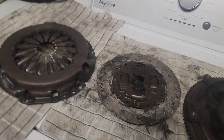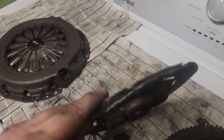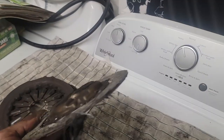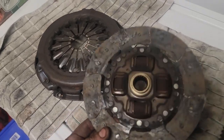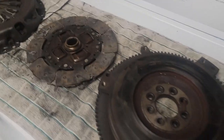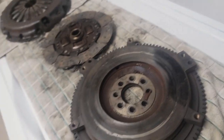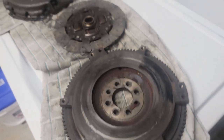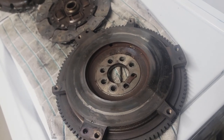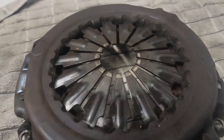For the flywheel, only eight bolts to take off — these are 12-point 14mm. Taking a look at the clutch, it is absolutely smoked — just shredded. There's nothing left; all the organic material fluffed out everywhere, and it's all in the starter and all over the inside of the motor. The flywheel itself has tons of hot spots all over it and is definitely not worth resurfacing — just better off getting a new one built to spec.